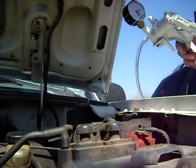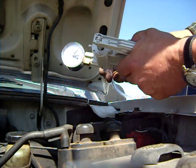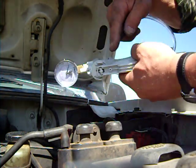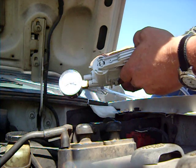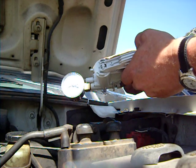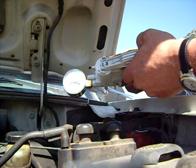So that being said, what you do is - I am going to set this down so you can see what I am doing. This is the vacuum gauge and you just squeeze the handle. Now the hose is open so I am going to check it and make sure the lines and everything are working fine. I am just going to put my finger over the end and squeeze it and you can see that it is definitely holding a vacuum. It is not leaking out so the gauge and the hose work fine.